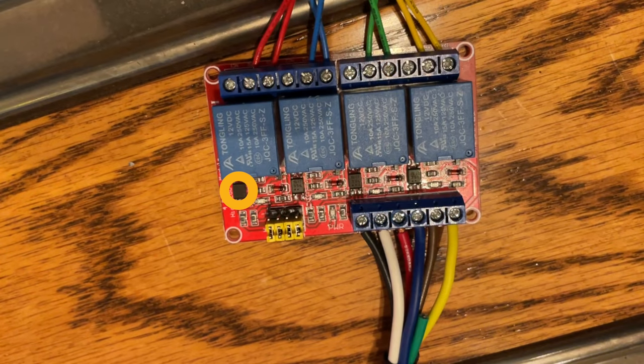On a brand new build, I'd lean towards the optocoupler because it has no moving parts and should in theory be more reliable. It turns out that many relay boards also isolate their triggers with optocouplers anyway, so at that point the relay is a bit redundant and truly only needed for higher-power applications than switching your own inputs. Now would be a good time to show you the system as a whole so you can form an overview of how it all works.